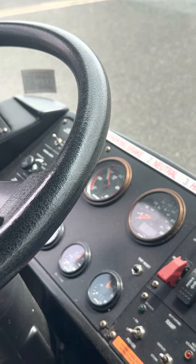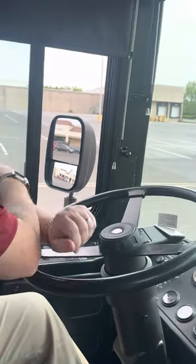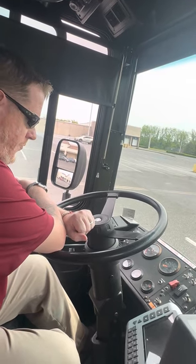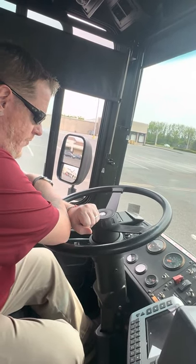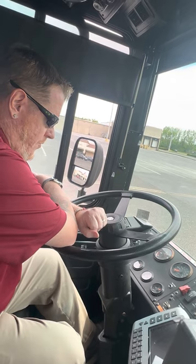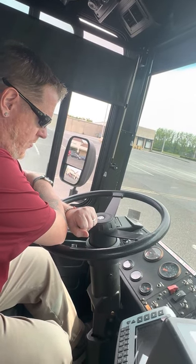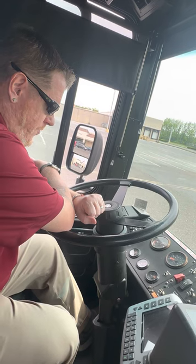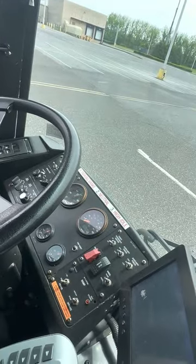On this particular bus, it popped at 60 pounds of pressure. At this point I'm going to start my bus to build back my pressure. That's my low pressure warning siren. My low pressure warning went off at 85 — between 85 and 100 pounds of pressure should take less than 45 seconds.